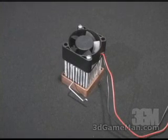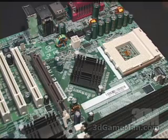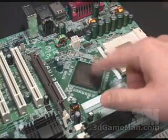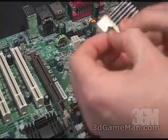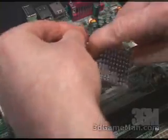Installation on AMD processor platforms does require some time. First, remove the fan on top, then slip the wire spring out. If your motherboard is installed, you'll have to remove it. Then remove the heatsink or cooler that's on the chipset, take off any thermal compound on the chipset, and apply some fresh thermal compound. There are also a couple of side brackets to install — one that goes here and one that goes right here.